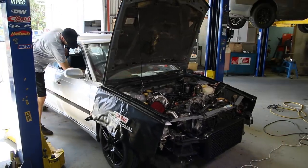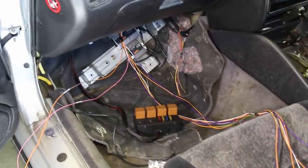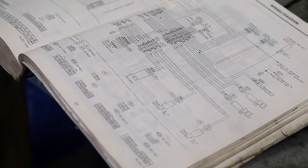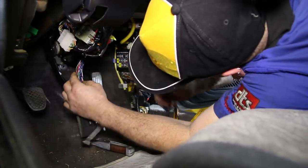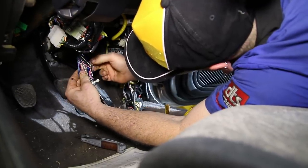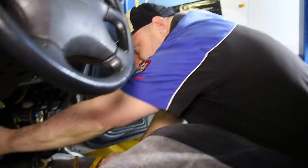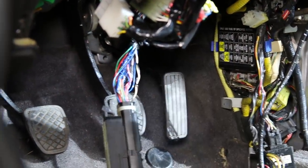We're pulling the car off the hoist so it's easier to contort ourselves under the dashboard. We then pull through some of the wires that need to be inside the car to interface with the factory wiring for the thermo fans and speed sensor. This setup varies from car to car so a wiring diagram helps identify what does what. We're tapping into one of the wheel speed sensors to get a signal for our speed input to the ECU. We'll just use one of the back wheels because it's less likely to get wheel spin when cornering or powering on. The wires are twisted to give them protection against interference.